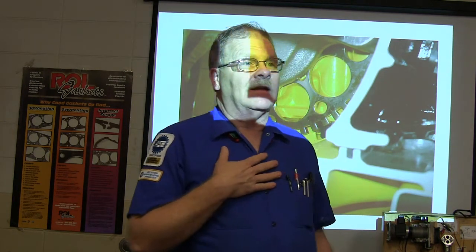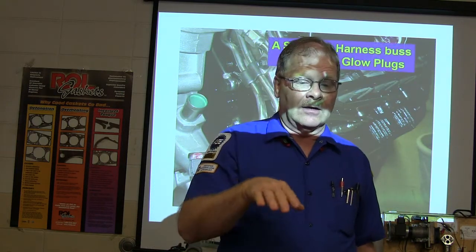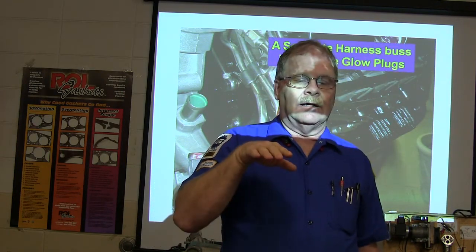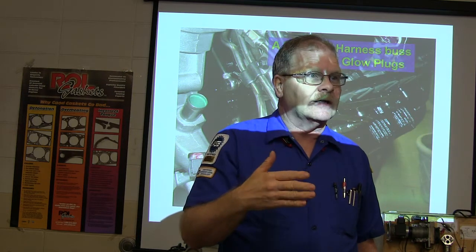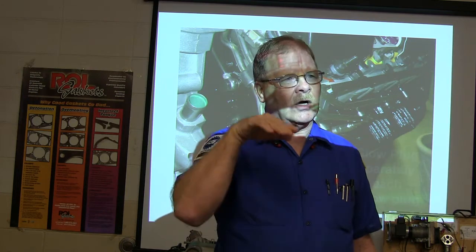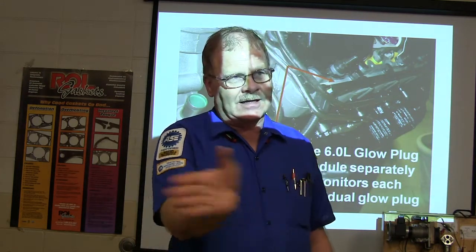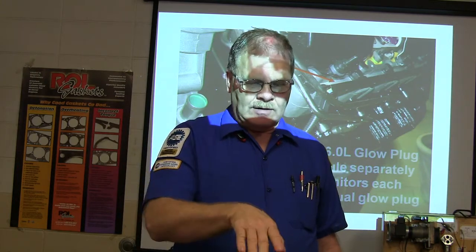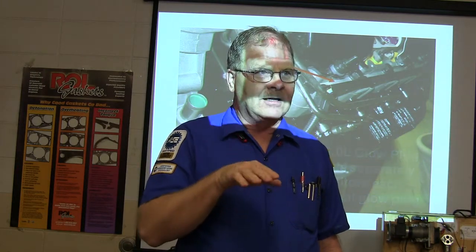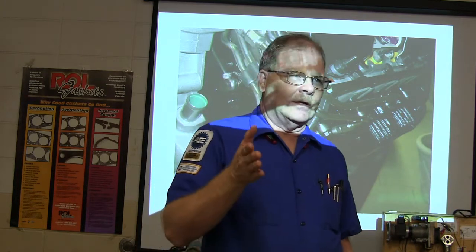The first time I ran into that, I was about 16 years old. I'm driving down the road, and it was raining, and I hit the brakes and it started to slide, and I was going toward an intersection, and I turned the wheels and the car just kept going straight. Unless you're in sand or something that can use like a rudder, when them front wheels are sliding, you're going to keep going straight no matter what you do with the wheel.